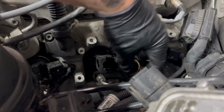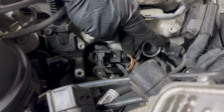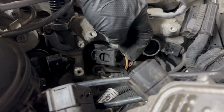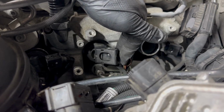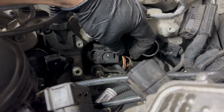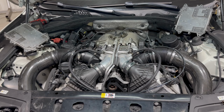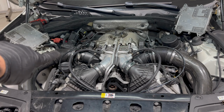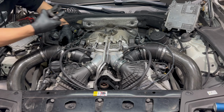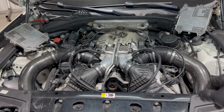And then on the connector, when you put that in, you want to have this tab here up, put the connector on, and it starts to close. A lot of them you can fully seat without pushing this on, but you definitely want to be able to put the top clip on, pull it, and not see a gap right there. But now that we have the spark plugs torqued, we know how to put the coils on. Put all the coils on the passenger side and the driver side, getting them all connected to the engine wiring harness.